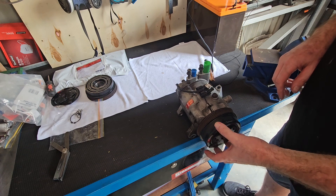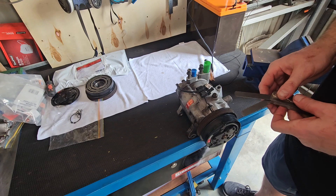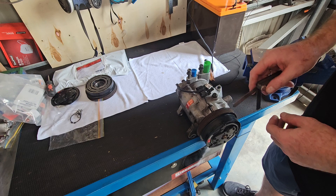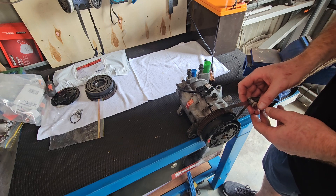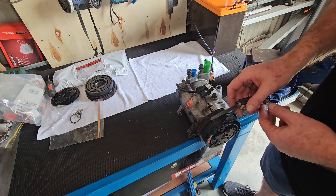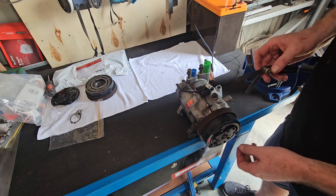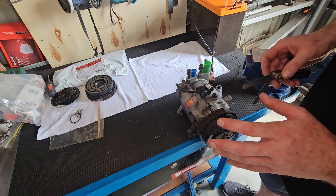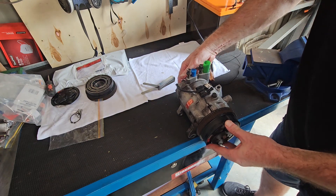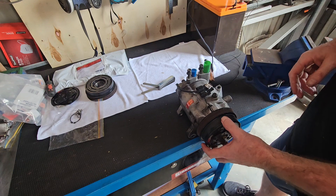This has a clearance, and the clearance needs to be less than 0.6mm. This one is 0.58, which is just getting through, and this one is 0.66. So this one here is probably sitting out just a little bit too much, so we can tighten that in a little bit. I think it's between 0.3 and 0.6mm, and that allows the clutch, when it connects, to grab better and work more effectively.